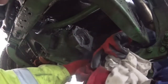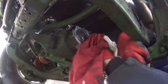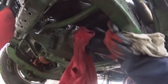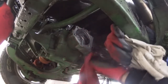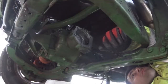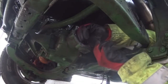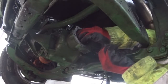What about that back bit? Well, that looks alright to be fair, mate. Do you want to get a razor blade on it? On what? It's dead easy if you just get a razor blade and just drag it along the top of it. Top of what? The surface. Oh, what for? To get the RTV off. Get it dead clean. Is it dead clean, is it? Yeah. Oh, right, decent. You done a smashing job of cleaning that up, boy. Is that a joke? No, it's decent.